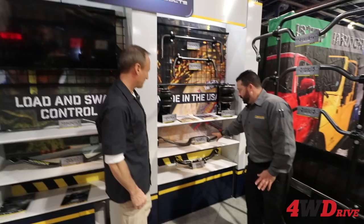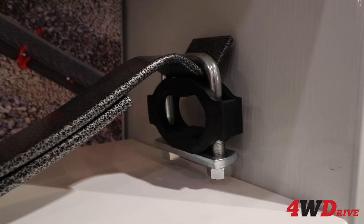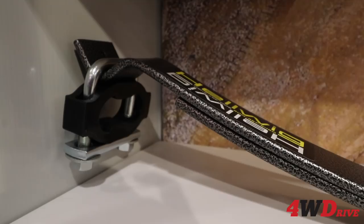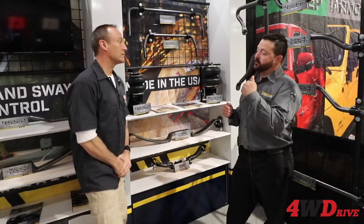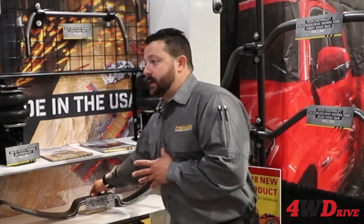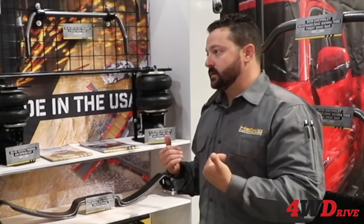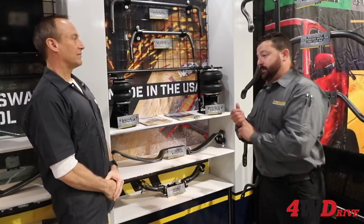We also have the 2019 Pro Series helper spring for the Silverado and Sierra 1500. In the corners you'll notice our polyurethane silent ride feature — it creates and maintains space between your factory springs and our springs, so over bumps or washboard off-road you don't get that clinking and clacking noise. The purpose of a helper spring is to keep the back end from sagging — I have a no saggy bottoms policy. When you put a lot of weight in the back, the back end drops and you lose proper weight distribution over front and rear axle. The Pro Series handles a level load capacity of around 2,000 pounds — a very inexpensive way to manage extra weight. All our steel products are American made with American steel and carry a lifetime warranty.